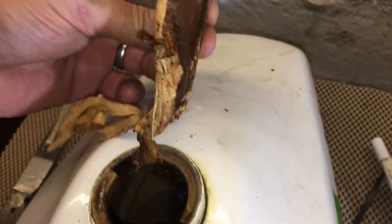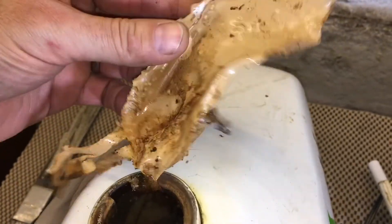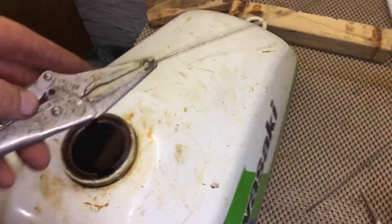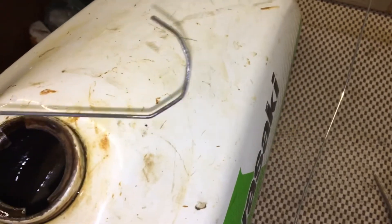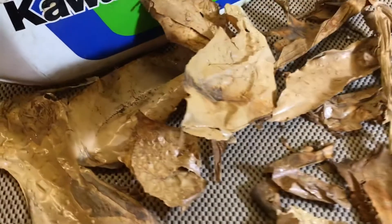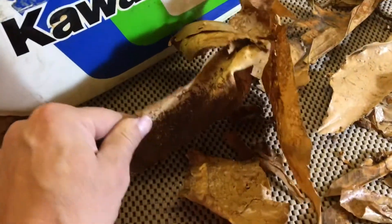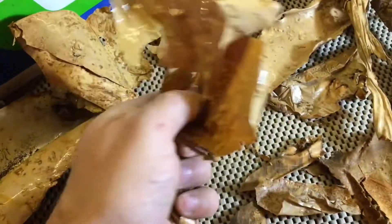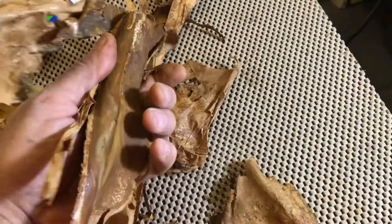That's good, because that's all the garbage inside the tank getting cleaned up. This was the first part of the old sealer that I pulled out — this stuff is nasty. I made a bunch of hooks and little tools from spokes, a tiny little hook to grab hold of the pieces inside that were already set loose by the electrolysis. I started pulling pieces out — look at this pile of garbage. Some pieces are really thick, some are really thin. It wasn't really well done and it definitely didn't seal at the point where it really needed to.